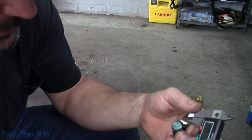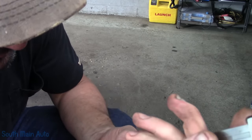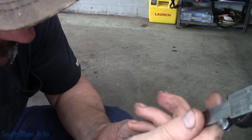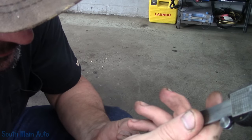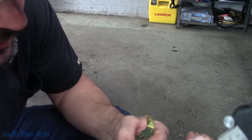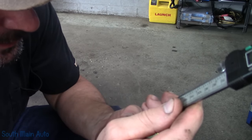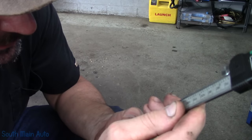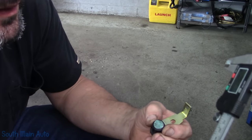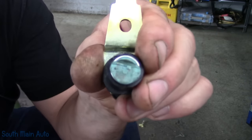Sometimes you can do it like this — just cut this loose and stick it in here. Run it down until it just touches the clay. Go down just a little bit further — it's kind of tricky to do. There, just put the dent in it right there. And we're at about 20–21 thousandths, roughly. So our air gap is around 21 thousandths, which is below the 30 thousandths minimum spec.